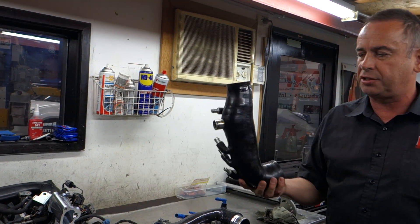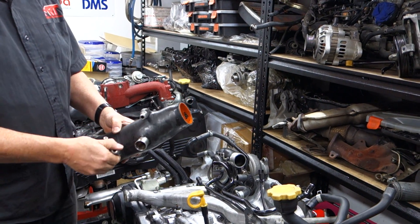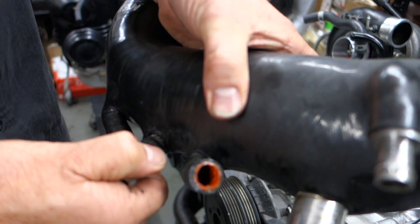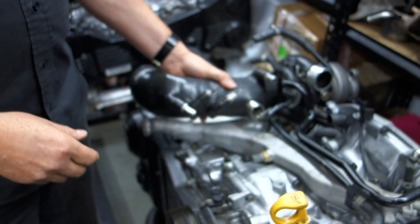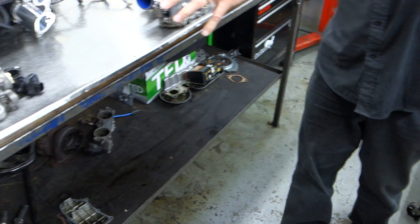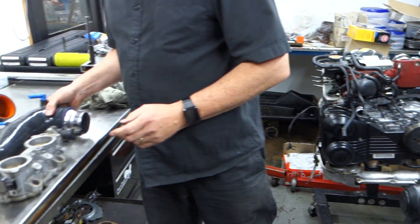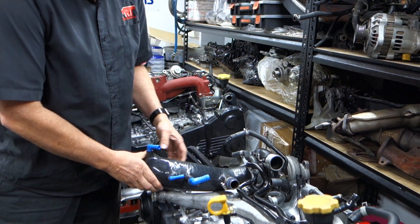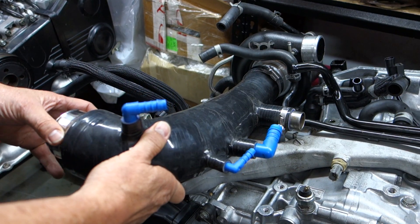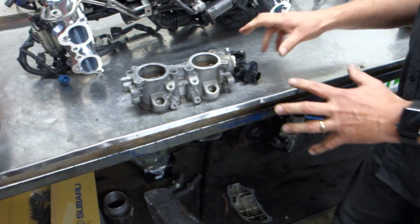There are these days lots of different air intake designs that fit the turbo assemblies, and this particular one is a Mishimoto one. Unfortunately someone previously when building the engine was a little bit brutal - you can see things are falling apart. If you look closely here, someone's damaged the silicon hose and it's split, so we're not going to reuse this one. They'll just go to spare parts. The air intake is over here, and the inlet manifold sits on top. We'll talk about this manifold in a second - the throttle body location is different on this engine compared to previous models, so you'll see the different type of intake pipe we're going to use.